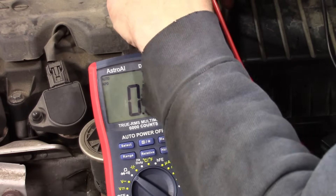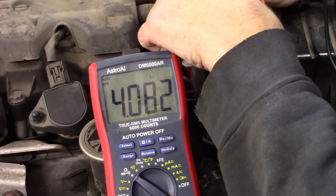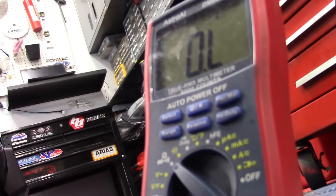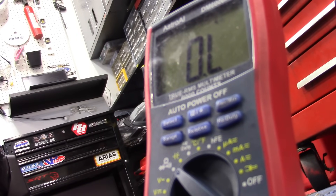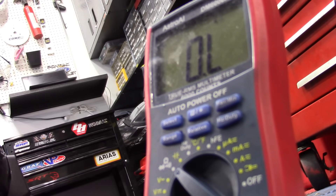With the car off, I measure ECT1 - the clearly replaced sensor - at just about 4,000 ohms. Now measuring ECT2, the second sensor down here on the radiator. I'm pretty sure we're going to read a higher resistance. And yes - five thousand four hundred seventy-seven ohms. That is clearly the issue. The electrical is fine; the sensor simply has too high resistance. Let me go grab a replacement sensor and talk to the customer, because the shop charged them for both sensors.